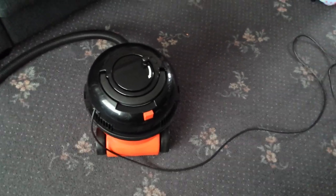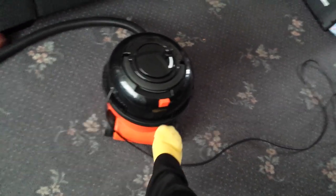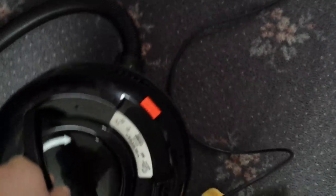There you go. Very prominent whistle from him there. Ugh, I do love that, as I'm sure you know. There we go. So it is a little bit louder than the Henry with this same motor that was before this model, which, like I said, had the rocker switch. Because the model before this had sound protection, sound deadening material, whereas this one doesn't.